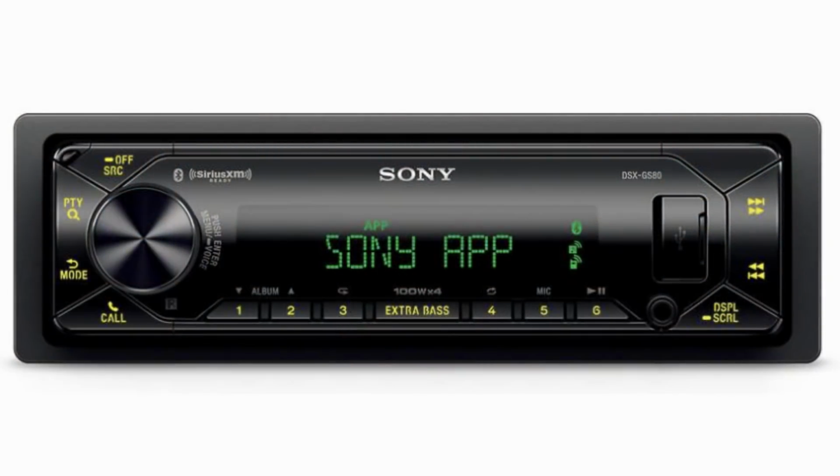I'm back with my final thoughts on the Kenwood Excelon X304 budget head unit. As you've seen in the test, the power output was on par with just about any head unit you're gonna get. If you're using it for the speakers, you're not gonna get much power. We already understand that, and we know that the 50 watts max power is kind of outlandish on almost any head unit you're gonna get outside of that big Sony I tested a while back. As far as the unit itself, this thing can be an 80PRS replacement. You're missing some features, like you don't have the full 16-band EQ, which gives you a few more tiny adjustments you can do. Crossovers are a little more limited, although the 80PRS is limited as well.